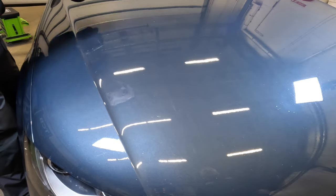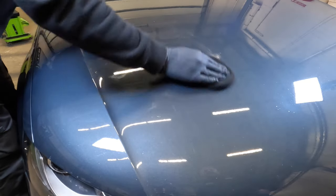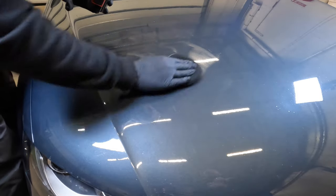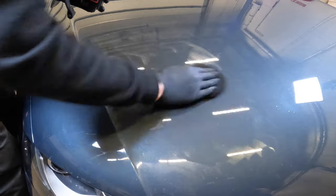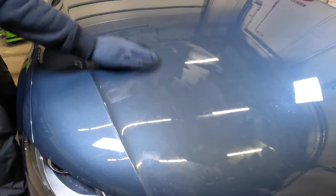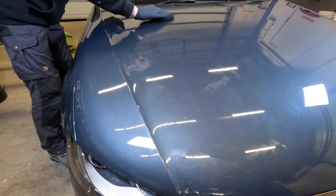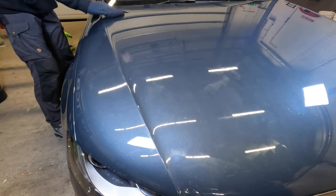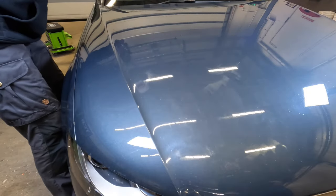See, that for me, that's how I prefer to put a wax on. Yeah, I think there is a bit of preference. I mean, some wax producers say straight lines. Some, like Mitchell and King, I always go in straight lines, I must admit. But this one's definitely a circular one. So the instructions say a thin, even coverage, and that goes without saying for all waxes. And then it says leave for several minutes, but don't let it dry. Then use one of their fluffy microfibers, turning it regularly. And then once you've done it, Carl, did it say try not to touch it for 3 hours? Yeah, so try not to touch it with your fingers for at least 3 hours. And then it's basically keep it out of the sun.